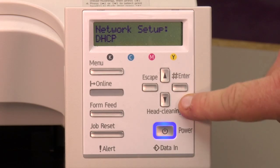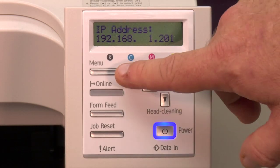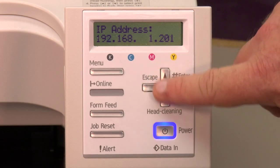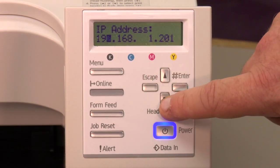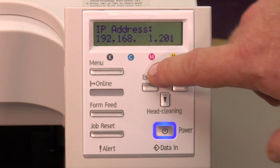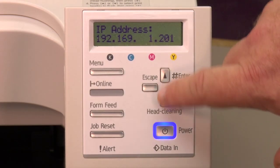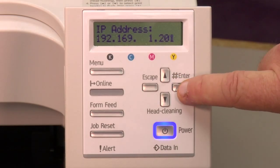Now when it's set, go back to the menu. You want to arrow down to IP address, hit enter, and program in the IP address that you have ready to program. You start with the first octet, use the arrow up or down to change the number. For this example, I'm going to use the IP address that we have here. Once you have the number entered, hit enter to move to the second set of numbers. Use the arrow keys to change the numbers, and so forth, all the way through the IP address.